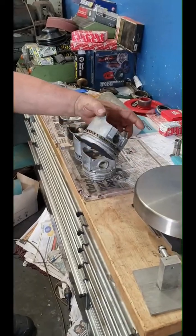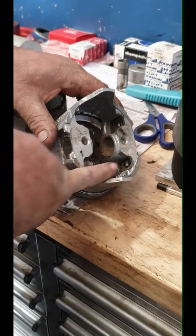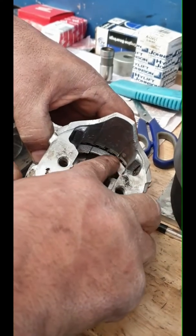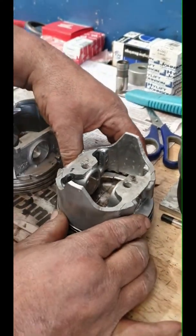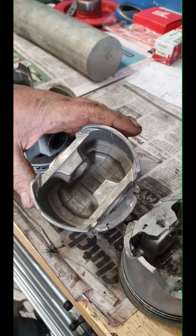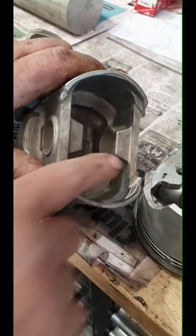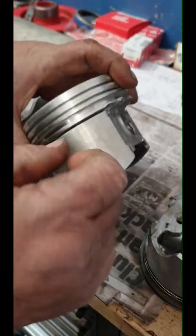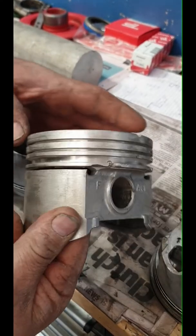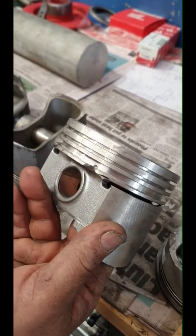This is a standard 351 Cleveland piston, came out from the factory. They've got steel inserts in them - see that? Middle plates. They're slotted here for the oil to return. That's a cast piston. This is a Holden V8 piston, which is sort of like the VN style injected ones, but it's a 308. Cast. They've taken away the steel inserts but they've still got the slit for the oil to come out through the sides. Not very good because it's relying on the oil to drain back through there, so if you use the wrong oil in it, it blocks up the ring.